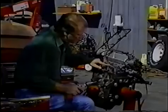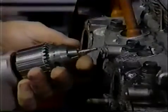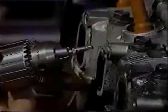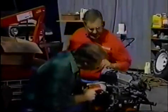Now I'm drilling out our stud. Once I get it down to almost a half an inch, I'm going to take this little collet right here on our extractor, run it up within a few threads, and then put it back in. Once I start up the drill, the collet will hook into the stud and should pull it out. Notice this is turning backwards. Those are really neat extractors — takes just a few minutes, that's for sure.